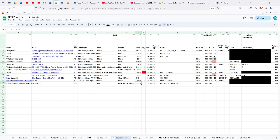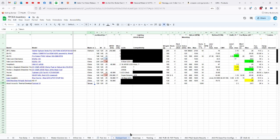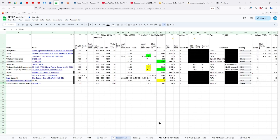Otherwise, it's not even worth it for three and a half dollars. Certifications: CE, ROHS, and two Asian certifications — I don't know how to read the language, so I can't tell you more about that. Made in Taiwan, 120 by 25 millimeters, two-year warranty, 110 grams, seven blades, 105 millimeters between the mounting holes. 1200 RPMs is the maximum. They did not list the airflow on the packaging, even though they claim the static pressure is 2.3.